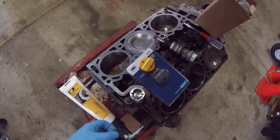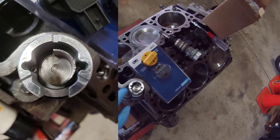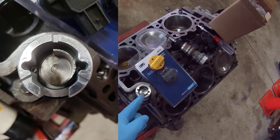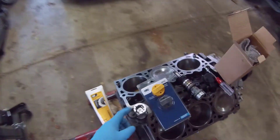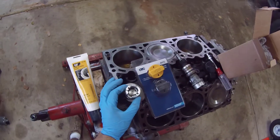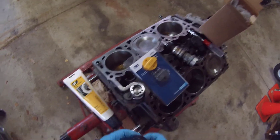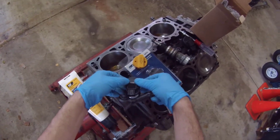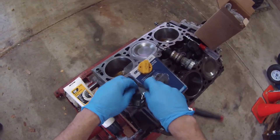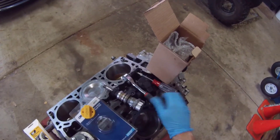You grab your sensor. Now, what you can do — and what you do with the early one — is you can get a marker and mark the synchronizer body and where this half moon is when you're on top dead center number one on the mark on the crank. Then you can rotate the synchronizer body to where you need it, tighten it down, and you'll zero it. But as I said, this tool makes it seconds of install. And if you don't have the tool and need to re-sync your old one, it's like $25–$30 — not that expensive. Just get it.